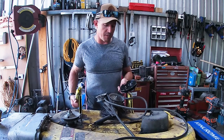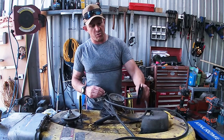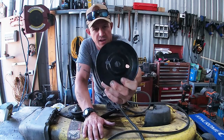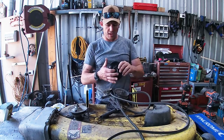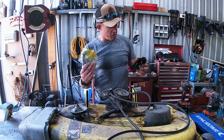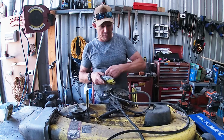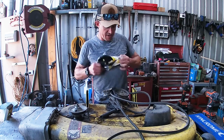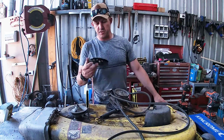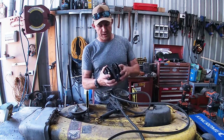Last time I had this off I was sharpening the blades and touching up a few things. During the welding I noticed that the pulley drives were starting to flog out — just over time the hexagonal fitting in there that mounts on them were flogging out. So I ordered two of those months ago. We've got the deck off again, so we've got an opportunity to replace those two today. Part number on here is UC2651 if anyone cares.